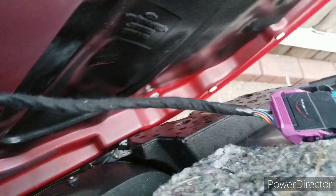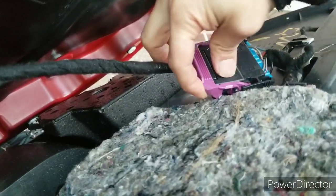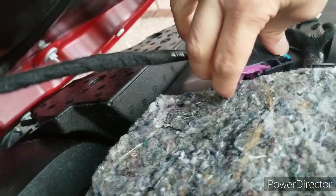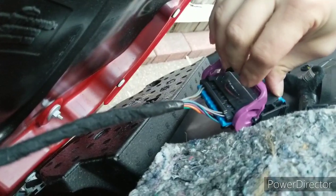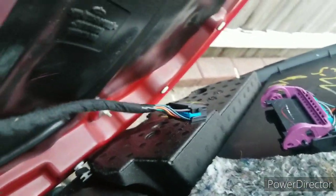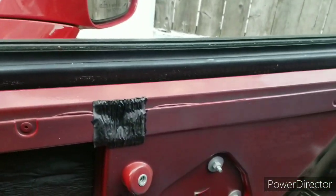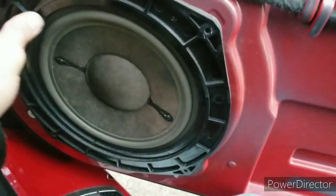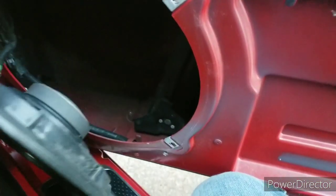I'm going to take this apart — you can see another video I'm making on that. Since I'm walking away I actually have to take the door panel off to get this off. I think we're gonna have to swing this upward like this — and there we go, everything comes out. Now we can assess the damage with the clips. Got the four 7-millimeter bolts off.